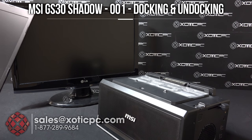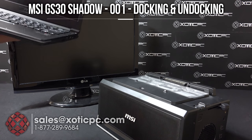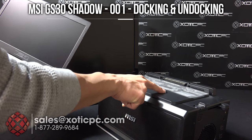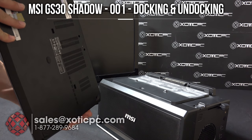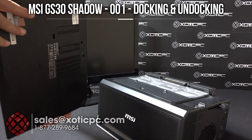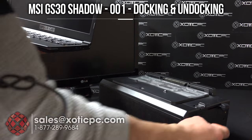We're going to show you quickly how to dock the computer to the docking station. The computer is turned off — you definitely want to make sure it is turned off. On the dock, you're going to see two little notches right here that come up, and those line up with two on the bottom of the notebook. So it kind of guides you to put it in the exact right place. There's a lock and unlock switch right here and a lever there.